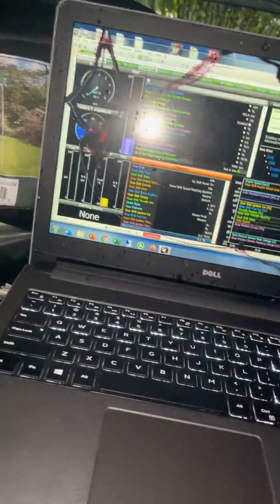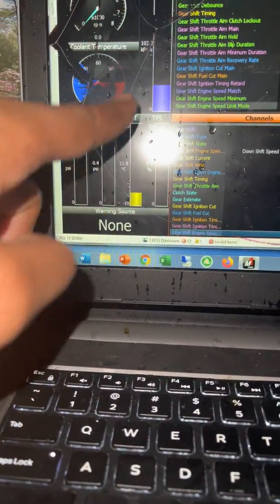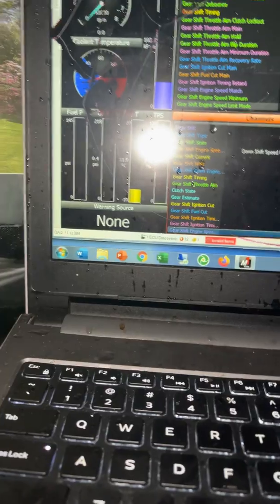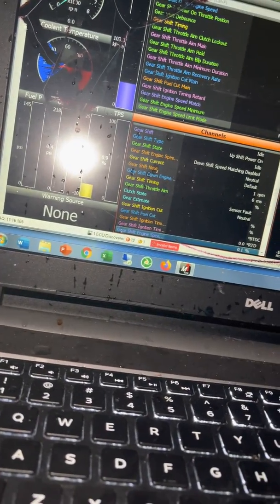What I am gonna do right now though is check for oil pressure. So in the meantime, being as I'm here, why not? Hidden behind this gigantic crack that we have is oil pressure. My injectors are actually turned off and disconnected, so what we're gonna do right now is basically crank the motor over. Fresh battery. Normally I like to do it with the plugs out, but everything's all buttoned up.